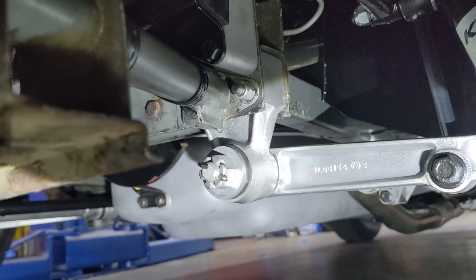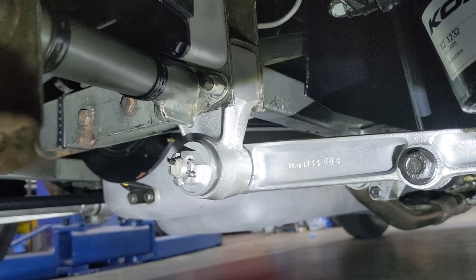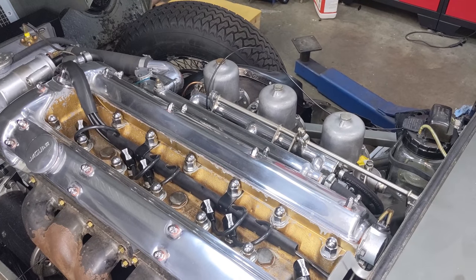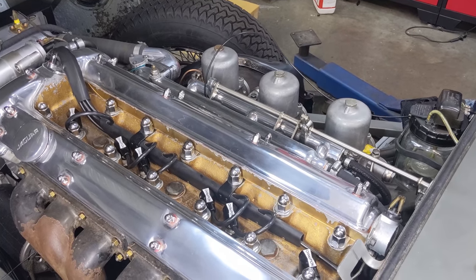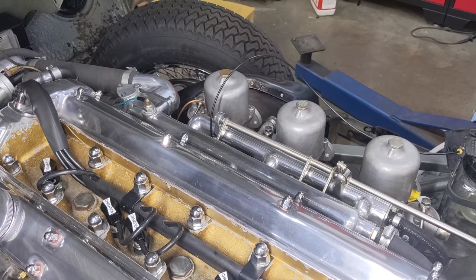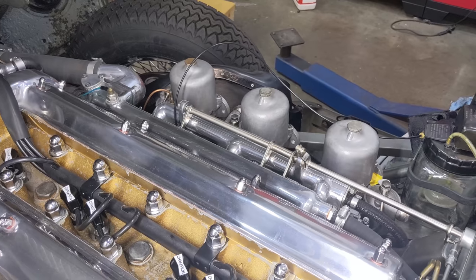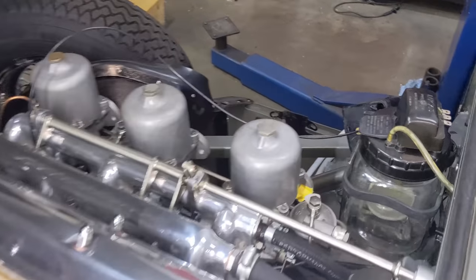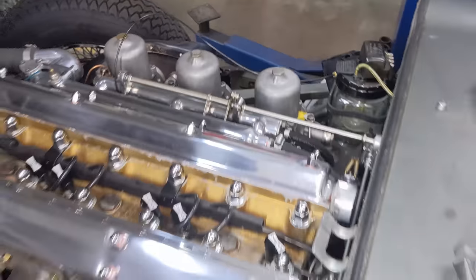That's super important. Now, I really want to get the intake plenum on, but the engine rebuilder chucked away the original oil sender, which is a real shame because if it worked, it would have been calibrated nicely with the dash. So I'm on a mission to find one that works. If for any reason on this test drive you see that the oil pressure gauge doesn't work, that's because we have an external gauge attached to the motor.